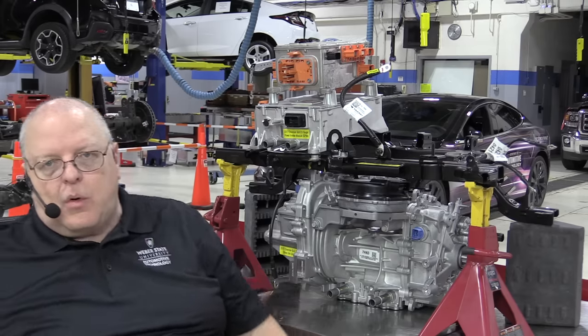These are all of the high voltage components involved with the Chevrolet Bolt EV, with the exception of the high voltage battery itself. I have a separate video on complete disassembly and reassembly of this battery. On the battery we've got two orange electrical connectors on the front: the large one is for DC fast charge and feeding the inverter, and the small one is for the plug-in AC charger. The little black ones are low voltage connections, and it's a liquid cooled battery with two coolant pipes — one inlet and one outlet.